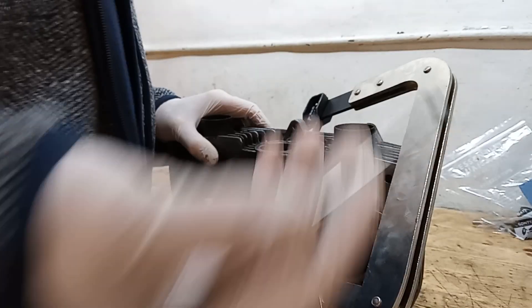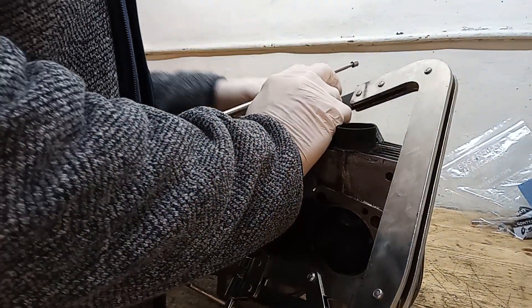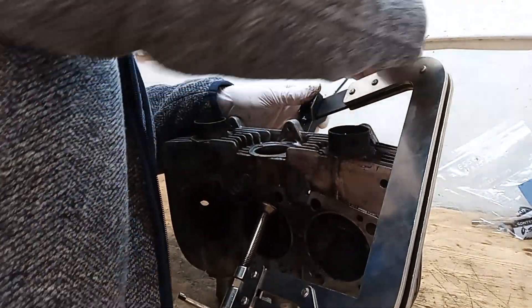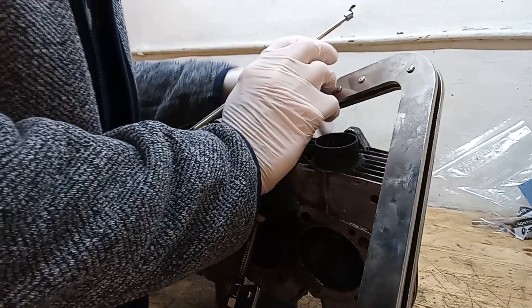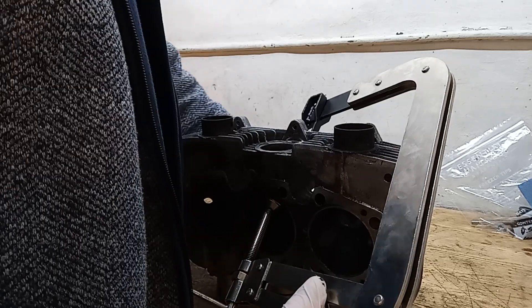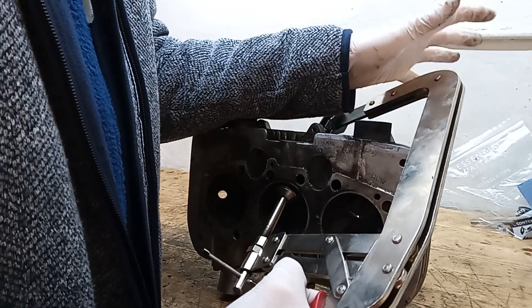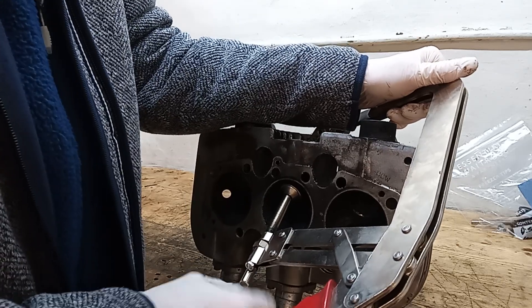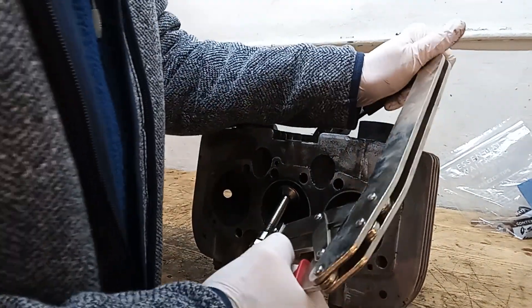I'm going to put my little magnet on now, and that allows me to pull one of the collets free. Then I get the magnet on the other collet on the other side of the valve stem - there it goes, that's both collets free. Now when I release the spring there are no collets holding it, so the spring will come straight up. I'll let the compressor go - it'll recoil a bit so I'll hold it so I don't damage the head. I should slowly unscrew it, but because I'm taking the valves out rather than putting them in, I can release it without too much risk.